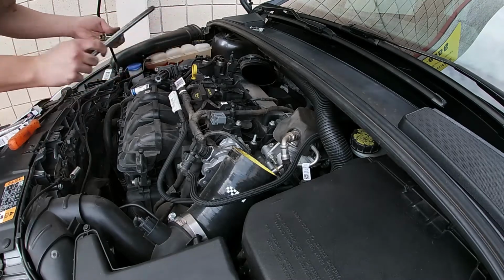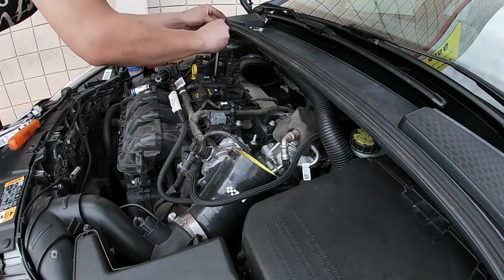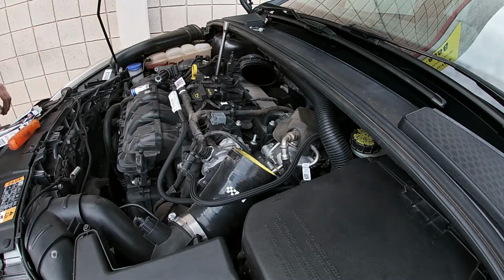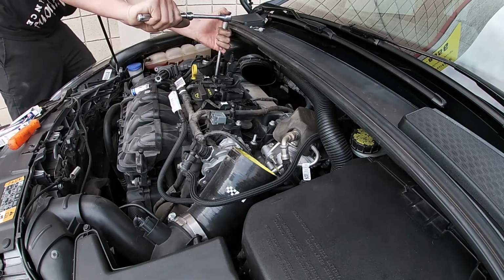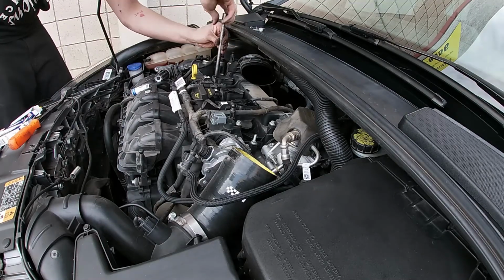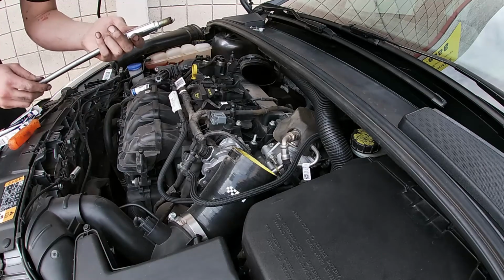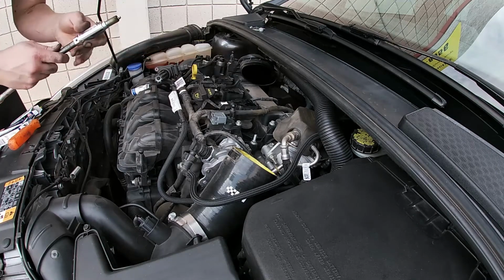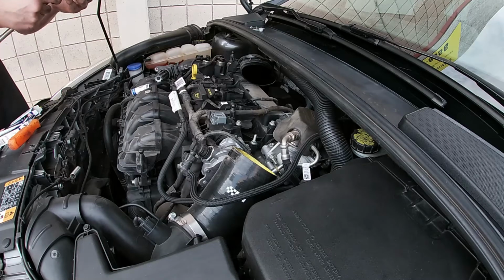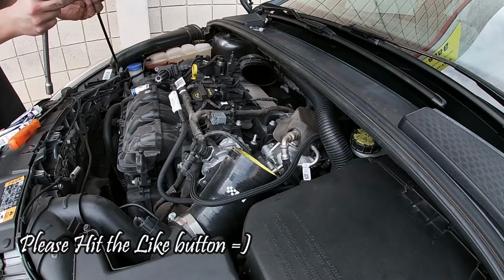We'll want a nice long 3/8 extension and a nice 5/8 spark plug socket. Doesn't look too bad. We do have about 57,000 miles on them though. When you're running tuned, it's better to change your plug a little early.